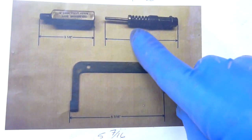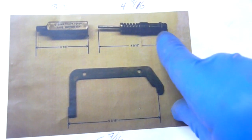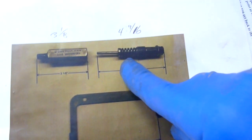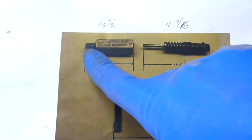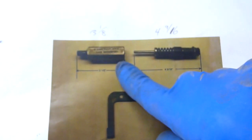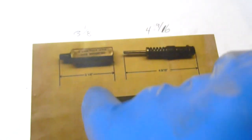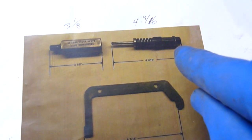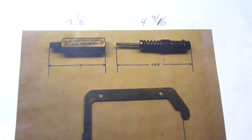This has a fairly thick spring and an actuating rod. The spring gets compressed with this knurled knob — six turns, they say. That puts pressure on the pin which then sticks out the end of this piece here. This is threaded into the servo. Then you have a lock nut on top. It's supposed to just seat. Then you adjust the band, which wraps up the band and pushes it against that pin, then releases this nut. As soon as it's released, the band is adjusted correctly.